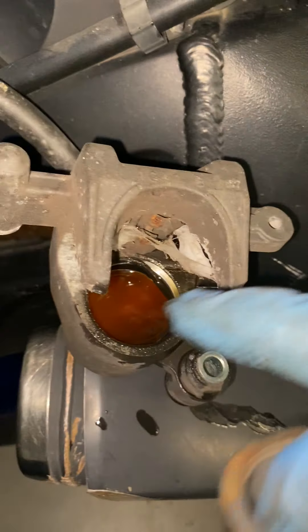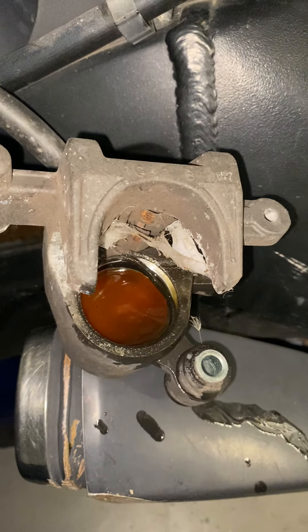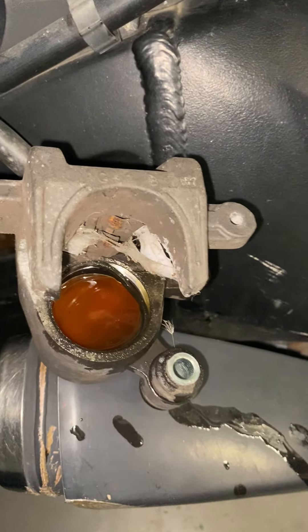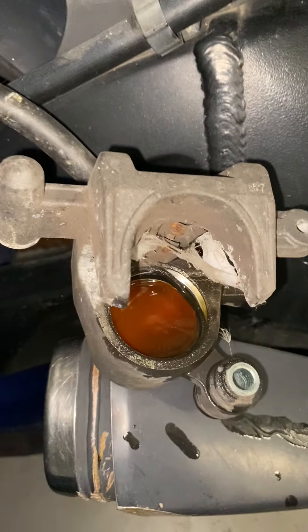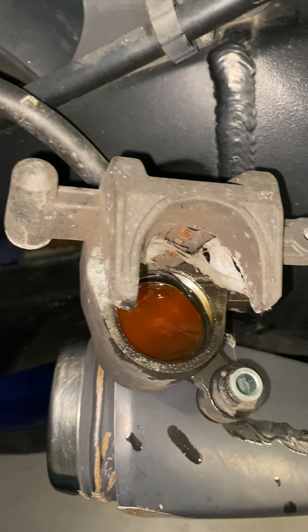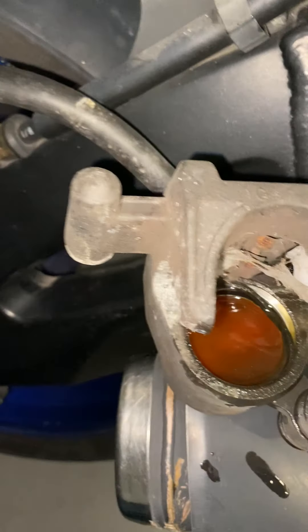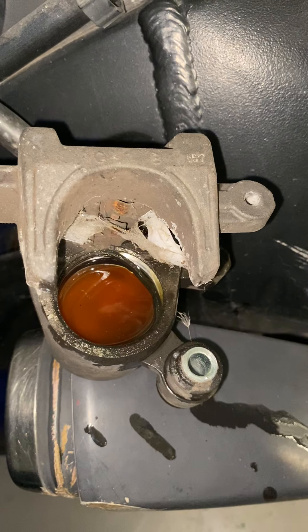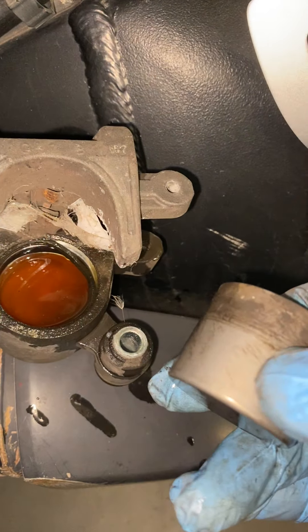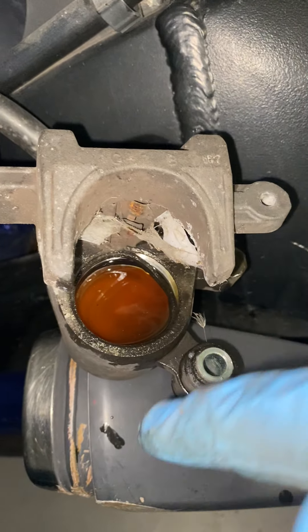So that's that with rear brakes. We're not going to clean it today, but once it is clean, remove both seals — the best thing to wash them in is soap and water, believe it or not. When putting it back together, use some clean brake fluid, wipe it around the seals, coat the seals with it, slip the seals back inside, and do the same with the piston — dab it with brake fluid all over.